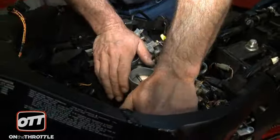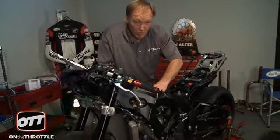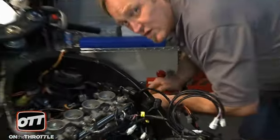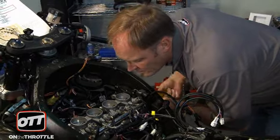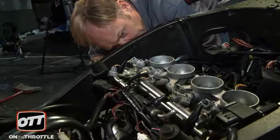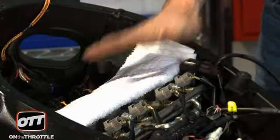There's very little now which requires us to get in very tight spaces, so I'd much rather put the throttle bodies back in, secure them, and drastically reduce the risk of anything falling into the cylinder. Make sure they're firmly seated and push down on the bike — make sure there's no wobble side to side. Go ahead and secure them with a screwdriver. Remember not to over-tighten these; when it gets firm it's pretty much good enough. We're going to put a towel across the top of the throttle bodies just to make sure nothing can go down in there, because one of those inlet valves is open.